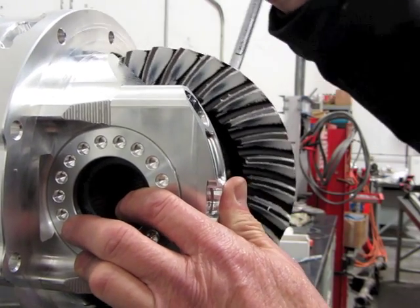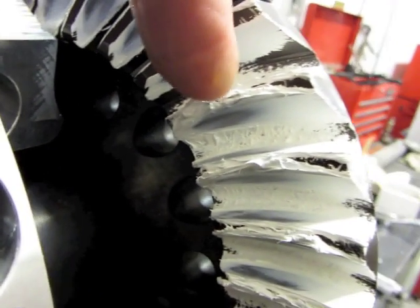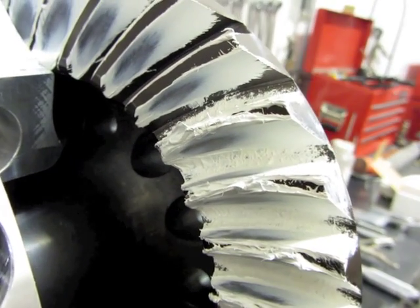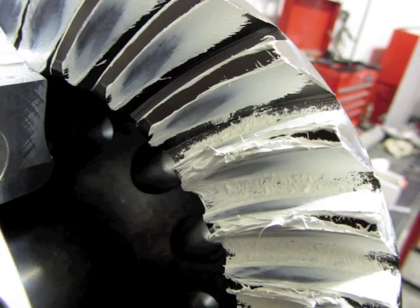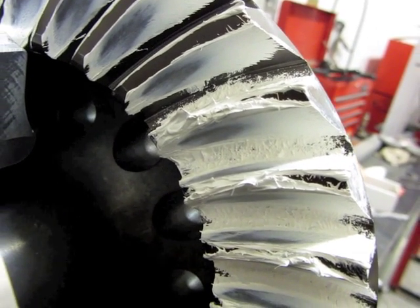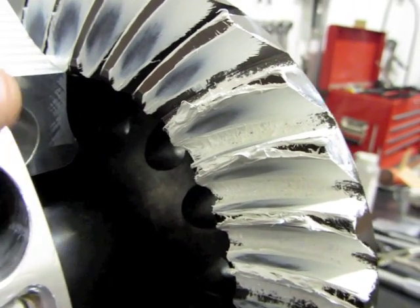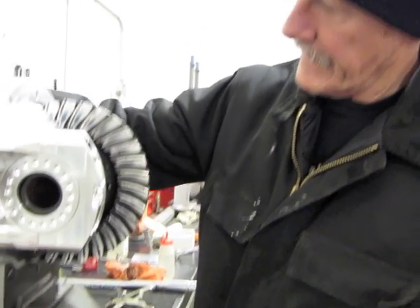Pattern looks a lot better now. Go straight down at that tooth and you'll see that the main contact — the darkest area — is basically across from under drive and coast. That's what you want to do: adjust your pinion depth. Your backlash can't be far out of whack or it's going to affect the pattern, so basically your backlash has to be correct. Adjust your pinion depth shims until you get your main contact bodies exactly across from one another on drive and coast.